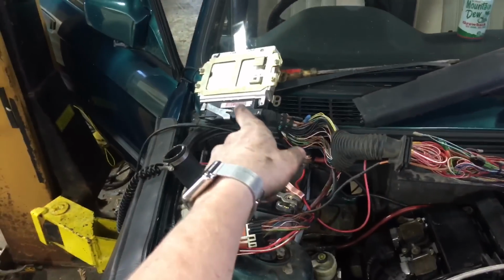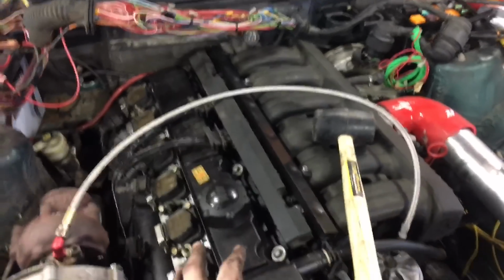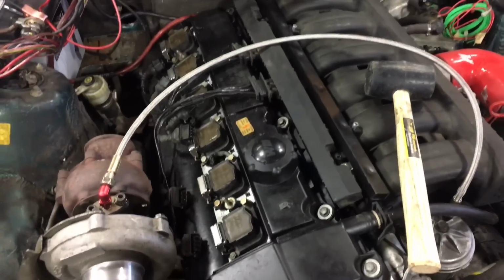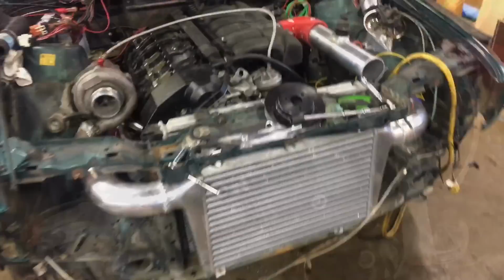I've actually got the Miller chipped ECU on it. I've got the turbo MAF on it. I've still got the leaky 60-pounders on it, so that might be a bad move, but I'm going to connect the coils and try to crank it here and hope for the best. Well, shoot guys, I'm pretty excited now. I'll take that as that being the issue.